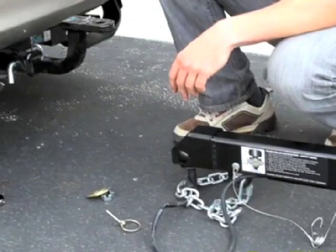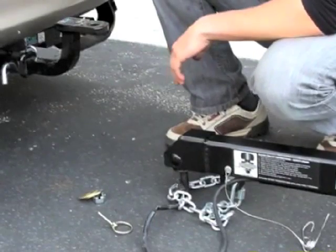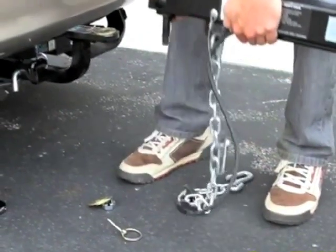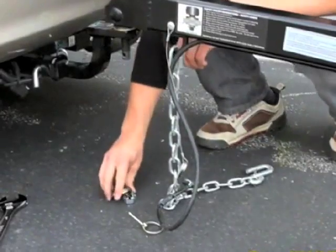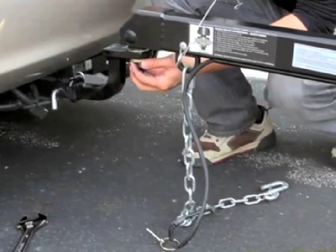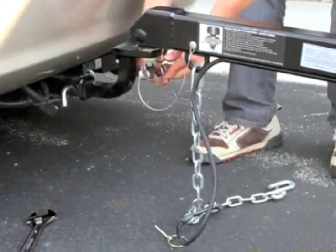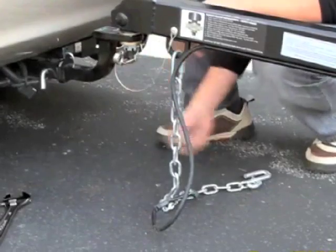To attach the motorcycle trailer to the car, it uses a system without the ball to make it more stable. Brass and steel washers are included. The brass washer goes on top, the trailer slides in, and then the steel and brass washer go on the bottom. Once the nut is on, a locking pin slides in to keep the nut from moving and secures on the other side. For added measure, another one of these pins goes into the very bottom and keeps everything in place.